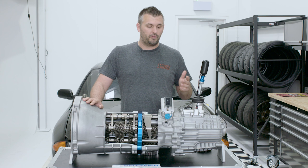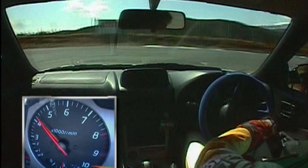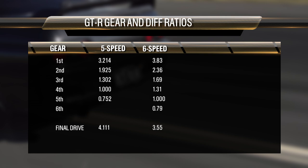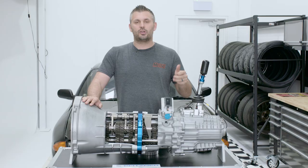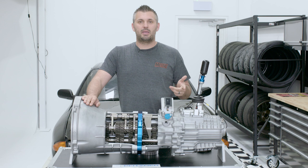Ratios are one of the most misunderstood but most important parts of modifying your car. Getting the ratios correct can totally change the way the car drives. We used the MINES R34 GTR as an example — its secret was diff ratios to suit the six-speed gearbox in it. Using our R32 GTR as an example, we switched from five-speed to six-speed. The five-speed had very, very long gears, which made the car pretty dopey down low. It was also dropping off boost between gear changes, and having gear sets that are too long means that often at the racetrack you'll find yourself at the wrong RPM in the middle of the corner and you just don't have the right gear for it. Switching gearboxes to have more ratios or closer ratios can give the car better response, make sure it's at the right RPM at the right time on the corner, and stop it dropping off boost between gear changes.